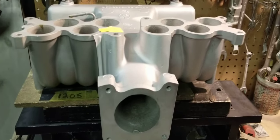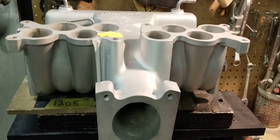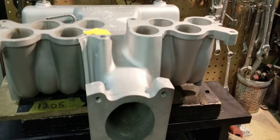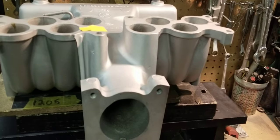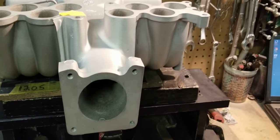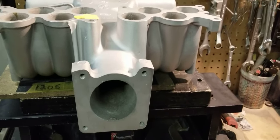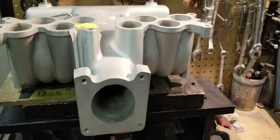Your motors deserve a lot better. When you port the lowers — and I don't mean this kind of port work, I mean real port work — and you bolt on a stock upper, even just a cleaned-up upper, it's not going to give you the CFM and the flow that you think you're going to get. The uppers are highly restrictive as well as the lowers. You have to port them together — not gasket match, not sand roll — you have to really port them.